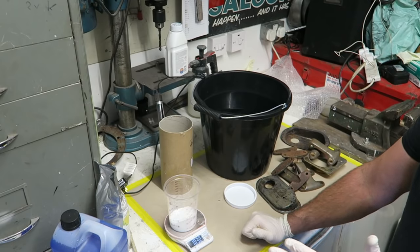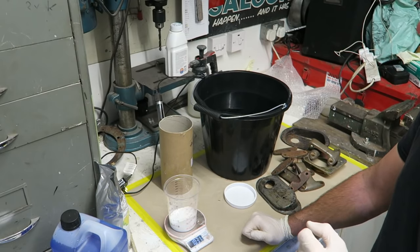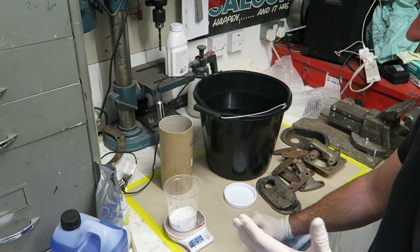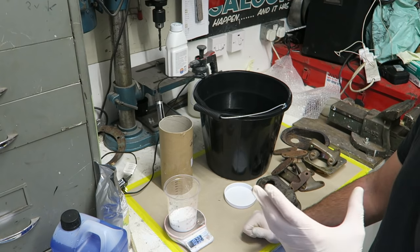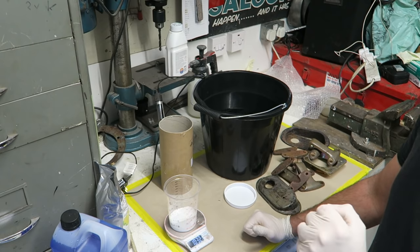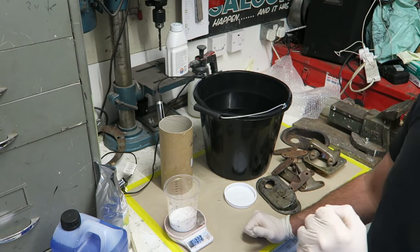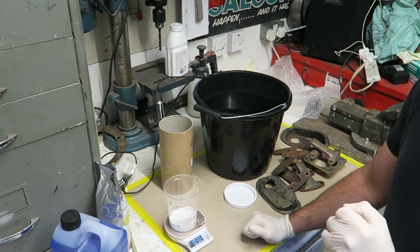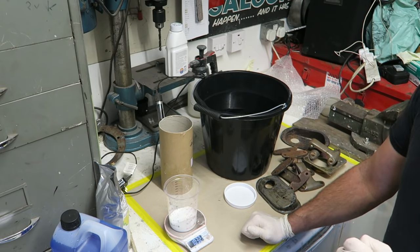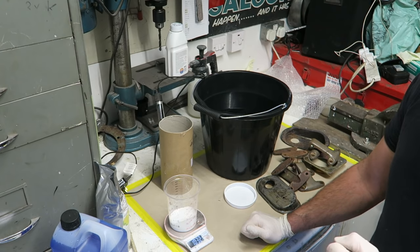If you put carbon steels in this solution, then you can have what's called hydrogen embrittlement, where hydrogen is absorbed into the steel components and it makes them brittle. So definitely no brake or suspension parts, which I know you're probably thinking as soon as you saw this: oh brilliant, I'll take those hubs off and put them in a vat of this stuff and they'll come out gleaming anew. Well, they will, but at what cost? I really wouldn't do it myself.